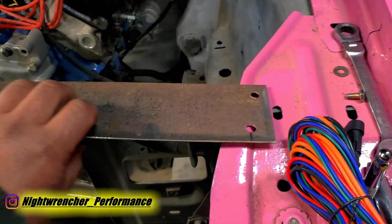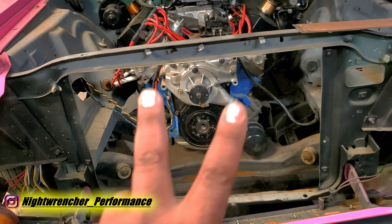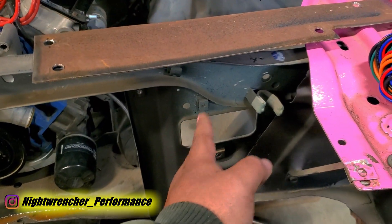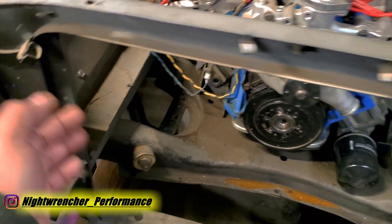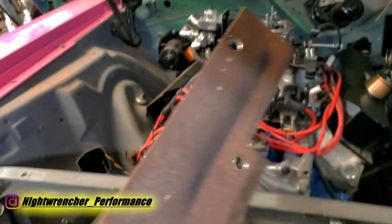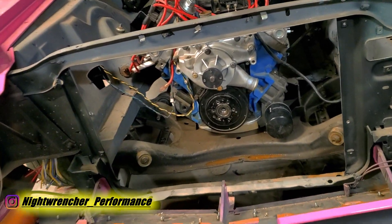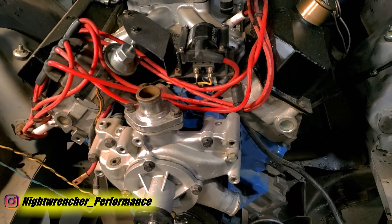On my previous radiator I had to make adapter brackets because the radiator had two sets of mounting points — two on the sides and two on the back. The side ones were too far apart and the back ones were too narrow, so I made custom brackets that bolted the radiator into the stock location. I used that for many months and had the same system on my '73 Charger with no issues. Now that I'm moving to a serpentine belt drive and thinking about installing other things in the future, I need more room, and this new radiator is going to give me that opportunity.